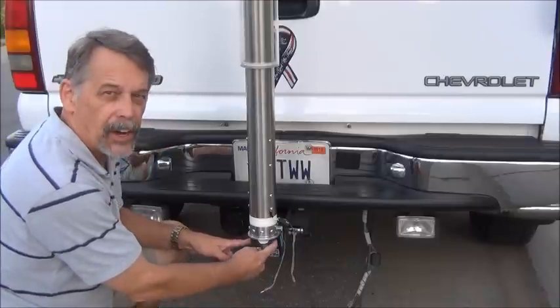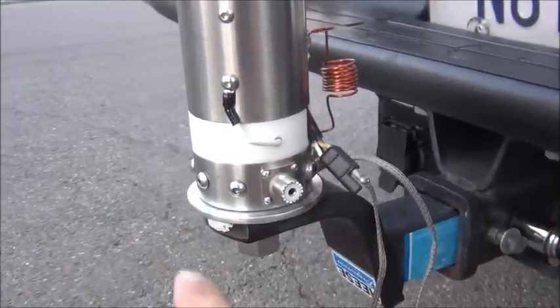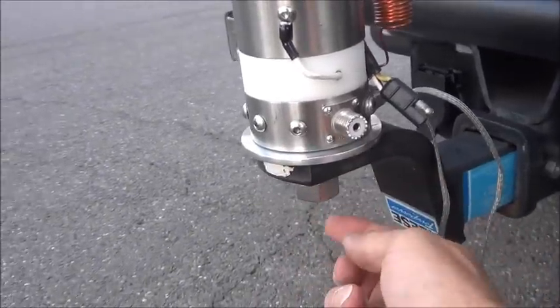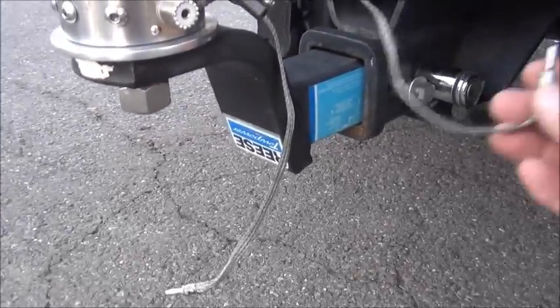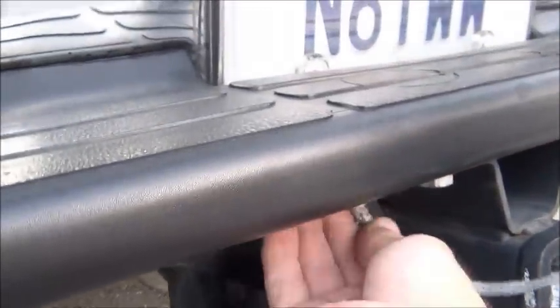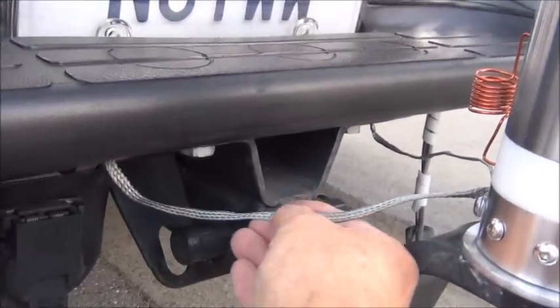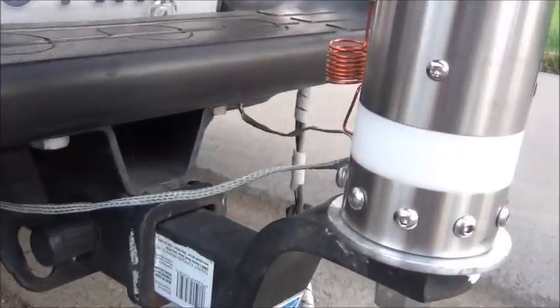Here's a close-up view. There's the lower plate that I made to fit on top. By the way, this mount has a three-quarter inch bolt that goes through the bottom here, so it's very sturdy. These lines here plug in to those plugs that I showed you earlier. So now besides being grounded through the frame and everything, it's grounded through here. I do have these bonding straps on different body parts and framework, and then of course there's a shunt coil here.